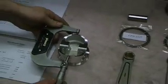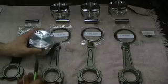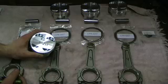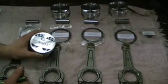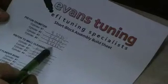We're going to look at the CP spec sheet, and it tells us we're supposed to measure 3.3253 inches a half inch up from the bottom of the skirt. Using my micrometer, I measure half an inch up here, and it reads 3.3253 inches — exactly on the dot. After measuring each piston, I label each one on top with its exact spec, then record every cylinder's clearance on the build sheet.